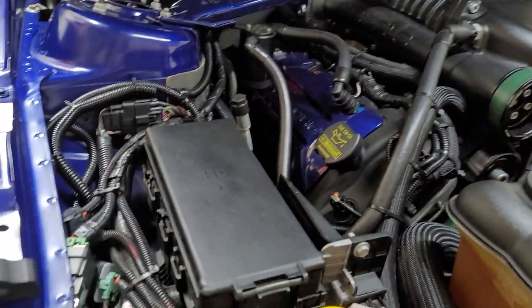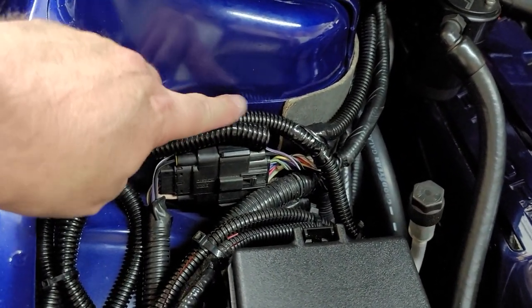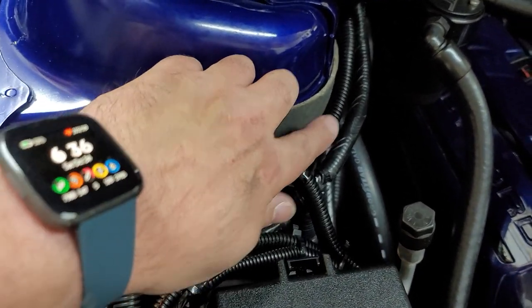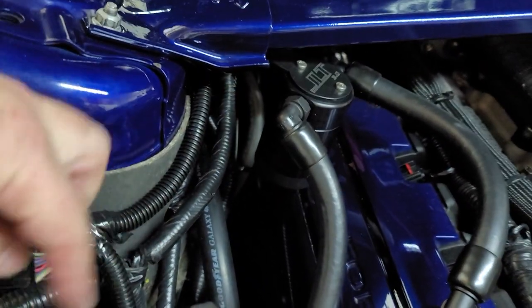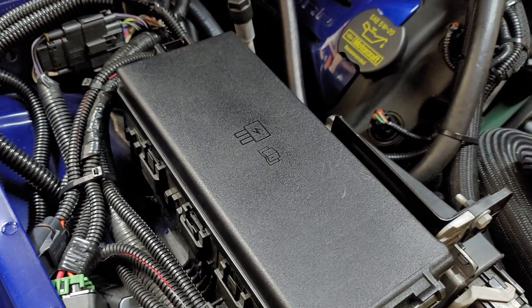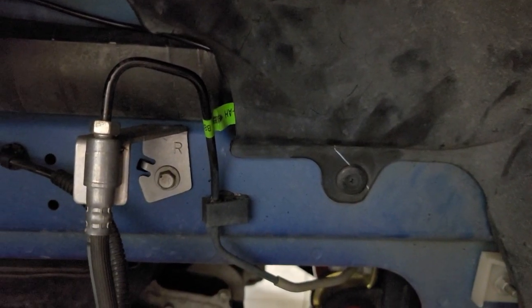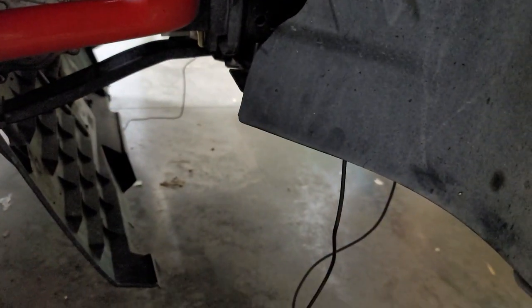All right, everybody. I did some rewiring. I didn't like the way that the wiring was going, the way I had it the first time. So what I did is I came up through the frame right here. There's a little hole. I did that. All this wire loom is the wire that came with it. And then I tapped it off, and that's where it's grounded, under here. And then the power is coming from here. The remote controls everything that's on your phone, so you don't need to have the other stuff going on. And then I checked all that, and down here, see if I got enough light to show y'all. It's right in here. The brain is up behind the panel. So I took the panel down with that screw right there and that screw right there, and I wired it all the way around up to here, so it comes out at the bottom over here on this corner. So we're gonna go ahead and try to button up some of this stuff tonight, so we'll see.